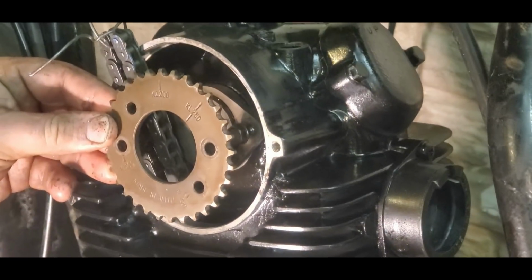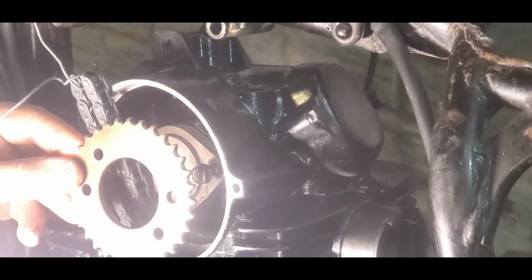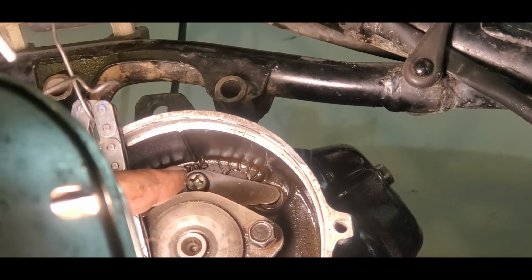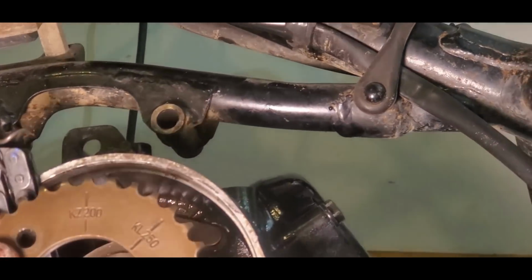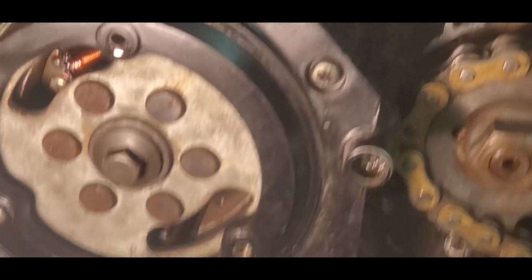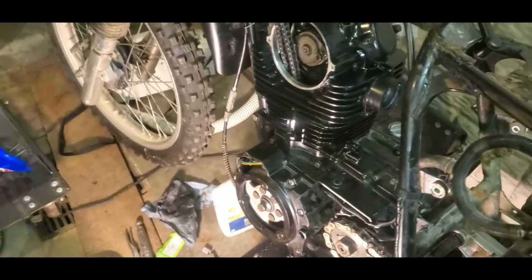When the KZ200 is pointing to the up position, there's a little metal tab in there that says top. If you get down here, there's a little metal tab right where my finger says. It says top. So you want that KZ200 line to be pointing to top, and you want your crankshaft to have on this line the T, just like that. I'll have to put this back into its chain and sync it onto the camshaft.